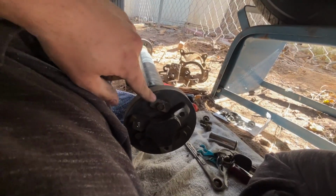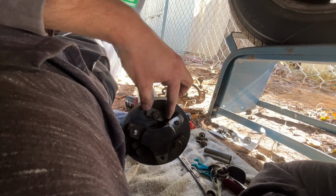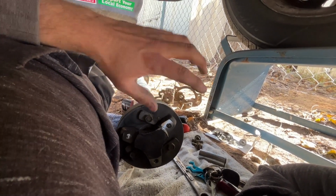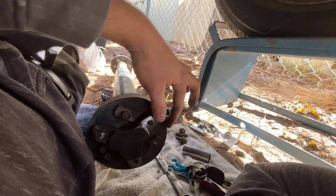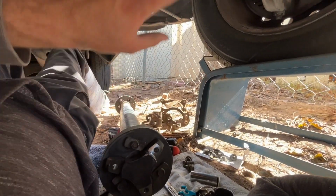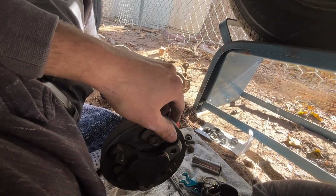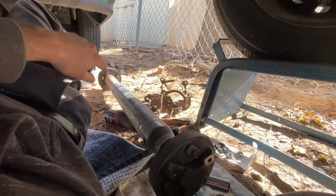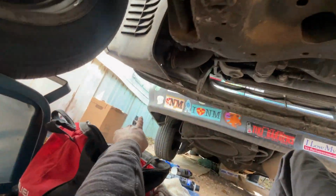Also, the way that all these dowels, or whatever you want to call them, these counterbalance weights, are aligned is completely incorrect. These should be like here. See how this one's out? These should all be facing out. There should be none of them facing inward. There's no need for that. They should be like a tire weight. So that's something else, you know. But we'll take this drive shaft out and replace the coupler, since I have the new couplers over there on top of the bumper.